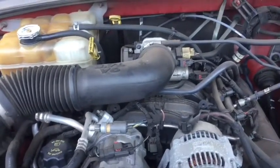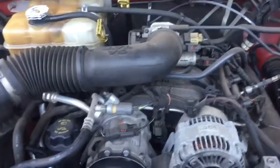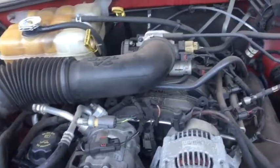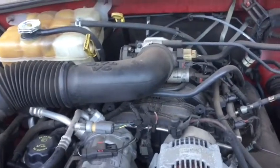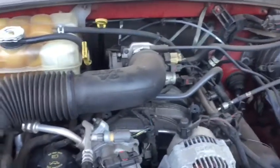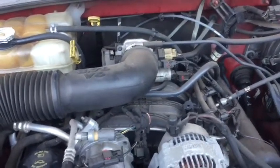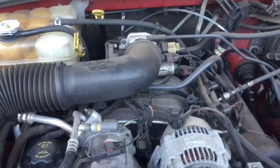Also, if you started it up and didn't get it to temp and say, oh shoot, I forgot to check my oil, and so you shut it right off, the oil's cold, it's a lot thicker, it'll take even longer for that oil to drain back into the oil pan, especially on a cold day. Summertime, not as long, the oil is going to flow back very quickly, but in the wintertime it can actually flow quite slowly. So that's why you want to have it up at operating temperature, and make sure that you've given it just a few minutes to roll back down to the bottom of the pan, and then check your oil. So an important little tip, this is your car guy.